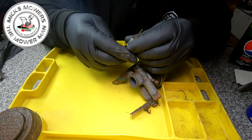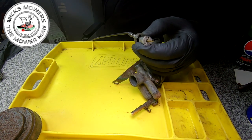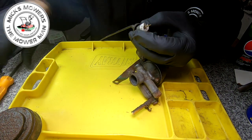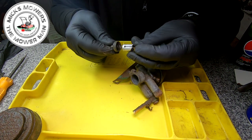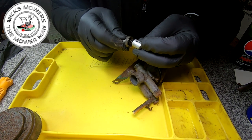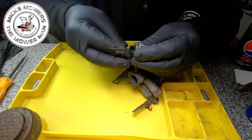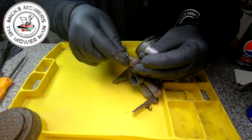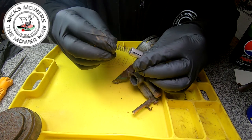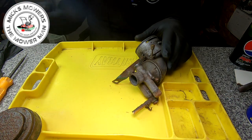There's a little tiny ball just here. What you want to do is get a little tiny pick or something similar and run your screwdriver down there just to remove that. Just push it down and there it is - then you can remove that out, bring it up into that hole, and it comes out altogether. You can then remove all of this top piece - it all comes apart. Put your spring back in and put your top hat back on top of your carburettor.